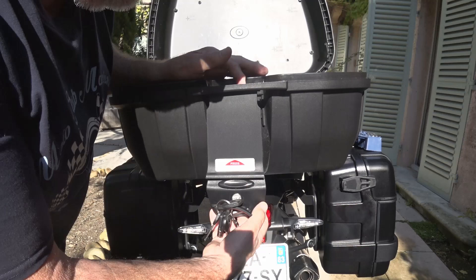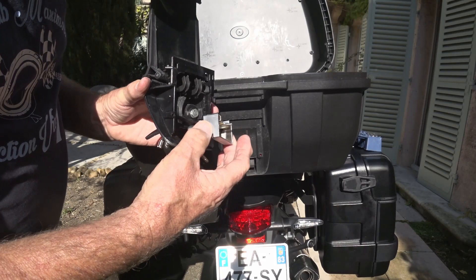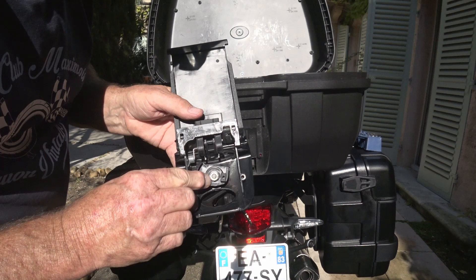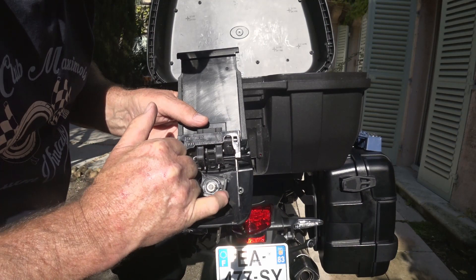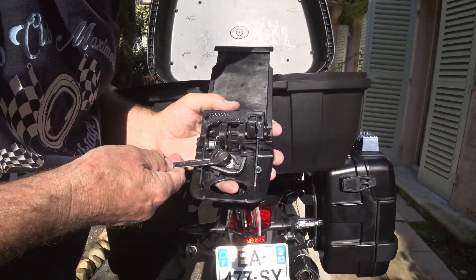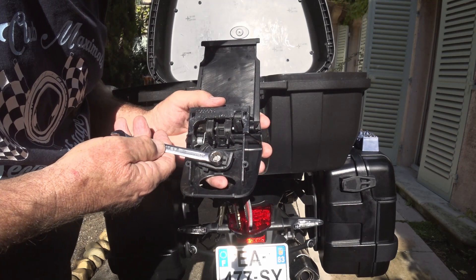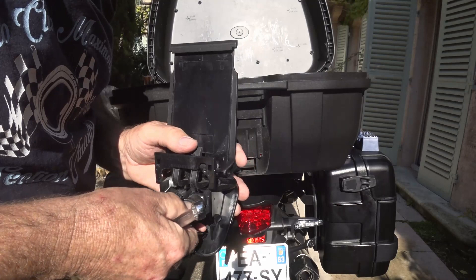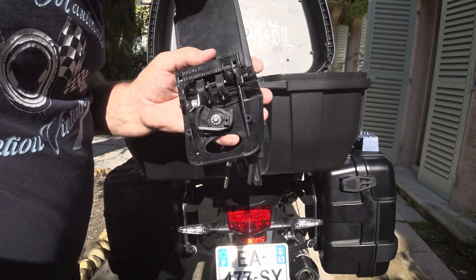This is just a little plastic push button - put it inside so we don't lose it. All we're going to have to do to change our barrel is undo this nut here. Undo the nut and we can take this. GV have given a new locking system there, so let's go on and do that. I'm using a 10 millimetre end spanner and we're just going to loosen this off. GV provide all these new pieces.